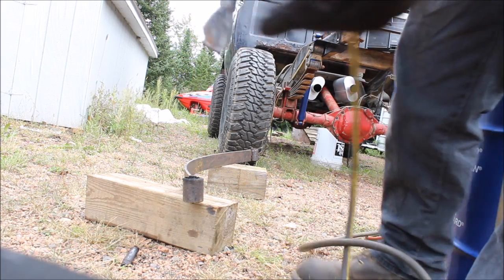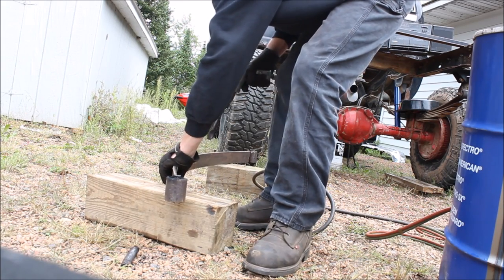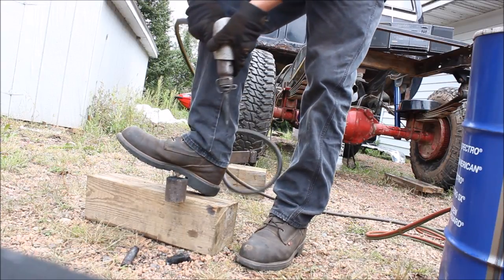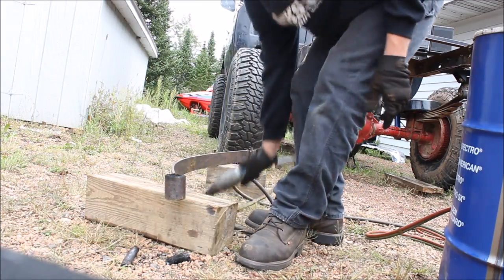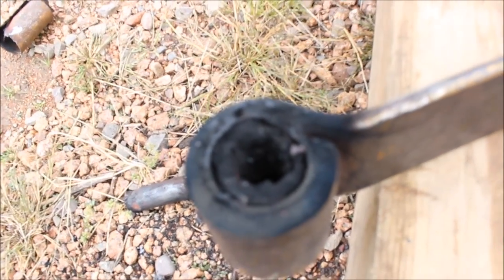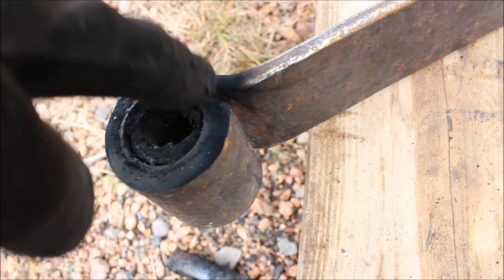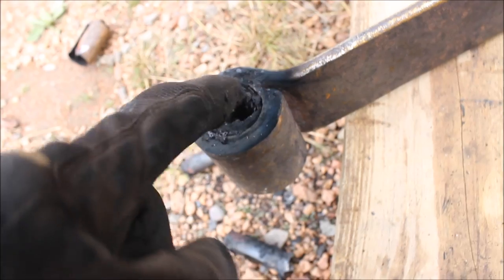You can see what kind of bit I'm running. Once it's hot, you hold the leaf spring down with your foot, get in there, and the inner pin slides right out. You see how the leaf spring has that little opening right there? You grab the air hammer and put that flat bit right in there and just chisel it through, pretty much splitting this inner metal liner all the way through. Then you start working your way around a little bit and it should hammer out super easy.